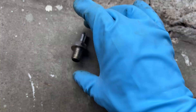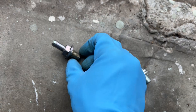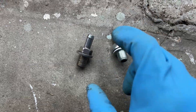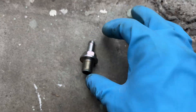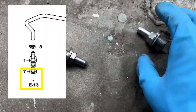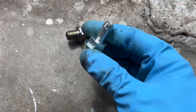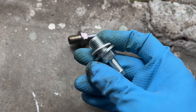As I mentioned, when I took this off there was no washer. I'm not sure what happened there — maybe when I took my car to the Honda dealership for service some time ago they encountered the same issue. Two possibilities: a long time ago they didn't need the washer so it was never included on the original and they added it in later, or they just forgot — ordered the part, it didn't come with the washer, and they just didn't put it in. In any case, we're going to use the crush washer, and I think that should solve many of our oil leaking issues.